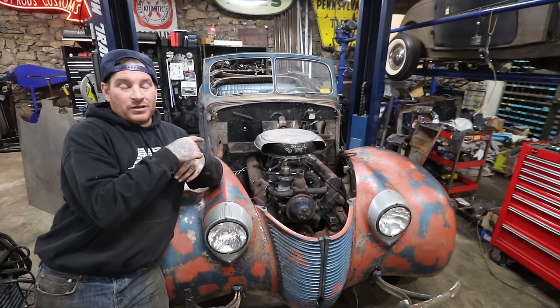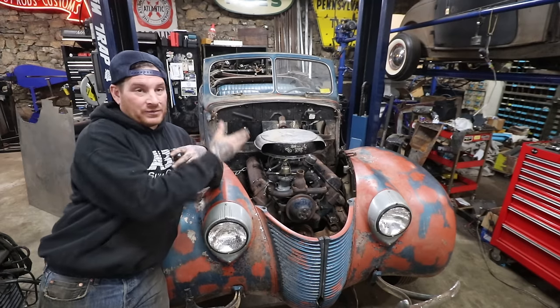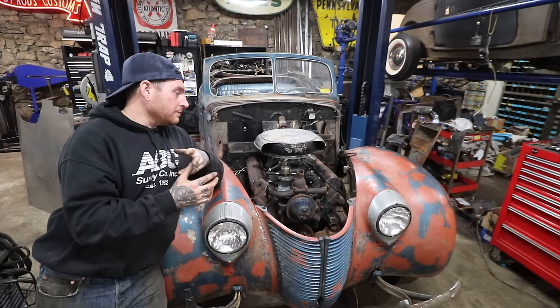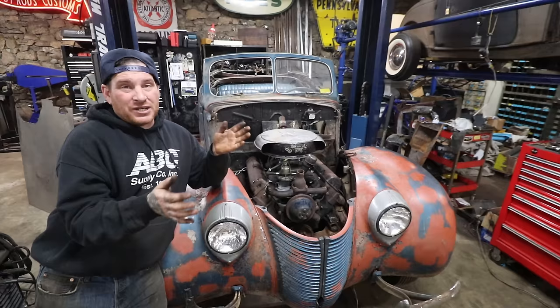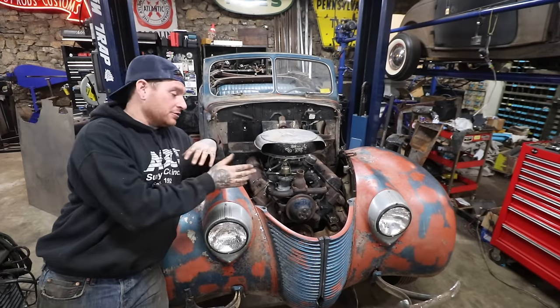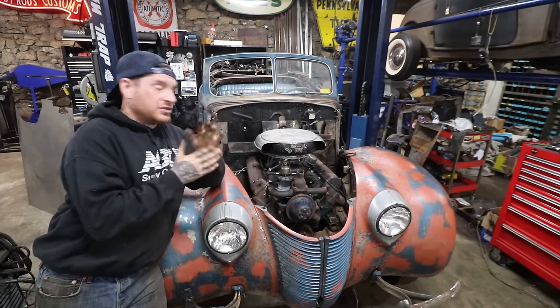We can pull out the old pedal setup they had and probably install a spoon type pedal or maybe even a 35 to 40 type pedal, I forget, or 37 to 40 type pedal. And we're going to test fit the radiator and all that stuff. We already measured the engine and trans to the Pontiac, and it was basically the same length, so the radiator should fit just like it did before. It'll be tight, but it should fit. And just start connecting the dots.